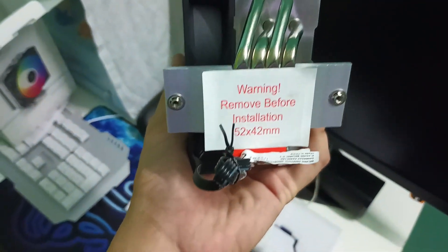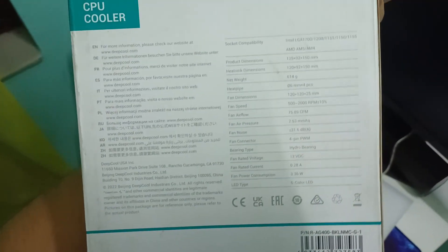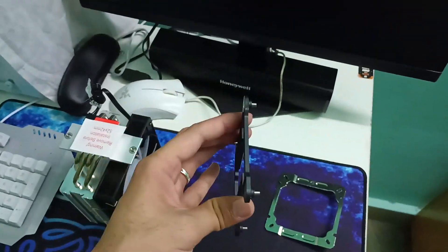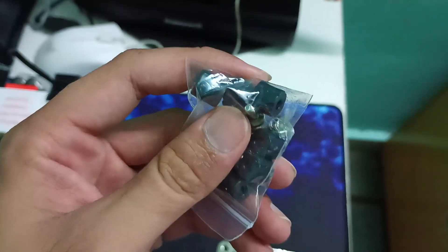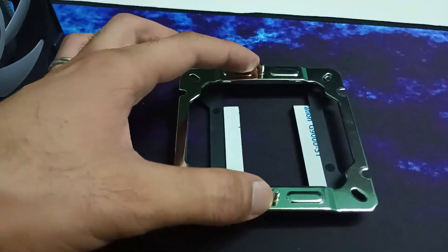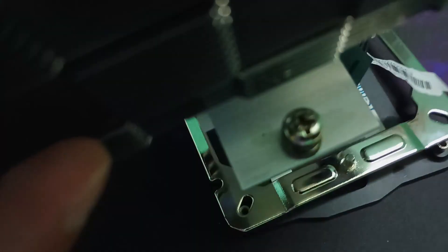Here we have the features of the rear dock mount. We have to attach it to the motherboard from the backside, then keep the motherboard over it and place these four supporting bushes over the motherboard to dampen vibrations. After putting these bushes, the bracket comes over them and we screw it in with the screws provided. Then these two-pin structures will fit into the air cooler and it will sit over these two pins.